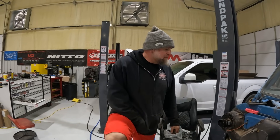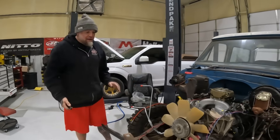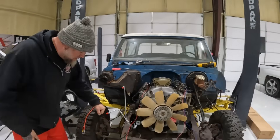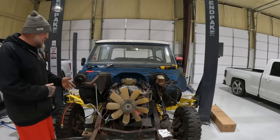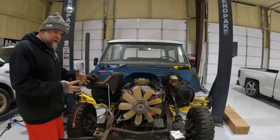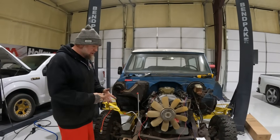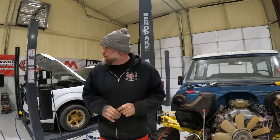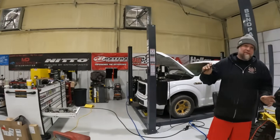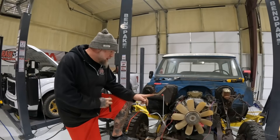We're making progress now that the boys are back. Before too long we're going to be putting the front end on it. We'll set a battery right here to start this thing up. The converter is bolted up — we pulled that thing out three times just for the converter. It has its extended snout on it and the flex plate has the dual pattern to fit this one. The previous flex plate did not — good thing we caught that.